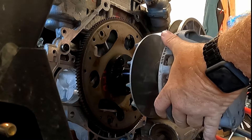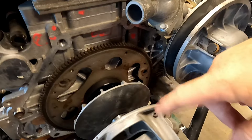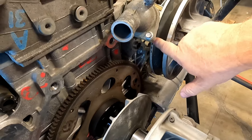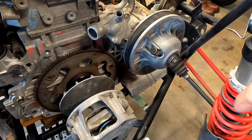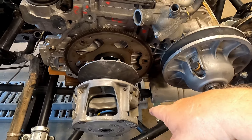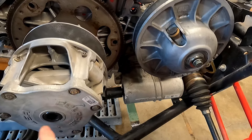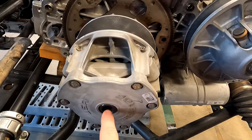The 900 clutch goes onto the taper about that much. It might squeeze a little more with the bolt, but we have the wrong bolt at the moment. So here's kind of what we're looking at — the clutch is on and it's going to line up with the belt-driven side. The engine needs to come up a bit — it's settled since we put it in. You can see what I'm trying to do here. It's just a simple CVT system like we use on minibikes. I need to maintain 10.5 inches from here to here so I can use a stock belt.